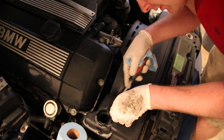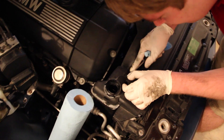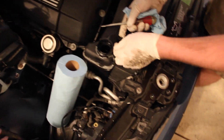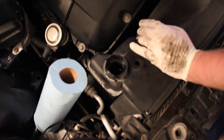We've got the fan and the fan clutch disconnected with the tool — sometimes that's easy, sometimes it's not. You may need a breaker bar for persuasion, a piece of wood to counter-hold the other piece — whatever works. Then we used a fluid transfer pump to pump out the coolant in the expansion tank, or as much of it as we could get out.